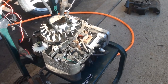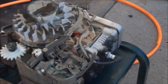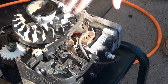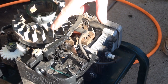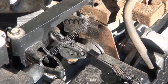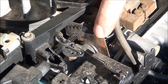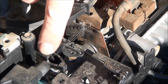A lot of folks have questions about the auto choke setup on a Briggs and Stratton engine. You can see it right here. The important things with this system: it rarely goes bad. But one thing that happens is people lose this spring here. You can see it attaches to this little tin cover and then it attaches to the arm right here.